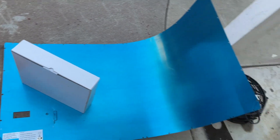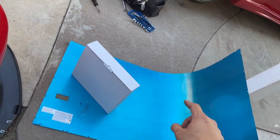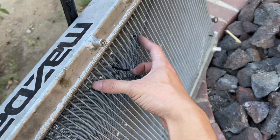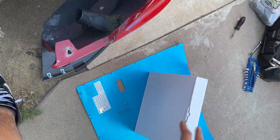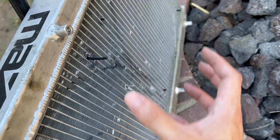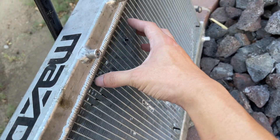I'm gonna take this chance to replace the fan and at the same time make myself a fan shroud out of some metal. Having a fan shroud is nice because without it you're only sucking air from the two fan circles, but if you put a cover on it you can maximize the whole area and make it cool better.